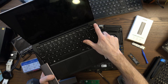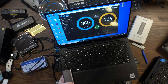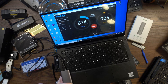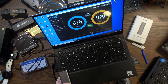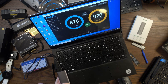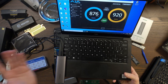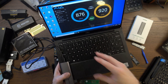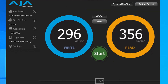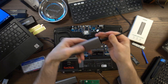Sales pages aren't always that useful, so you're better off testing things yourself. You can see the benchmark here — the target drive is the D drive, not the C drive. If you push start you'll get just below 900 megabytes per second for writing and just over 900 megabytes per second for reading. That is what you'll get with this enclosure with different NVMe drives on the market. These speeds will be a little slower if you connect via regular USB 3.1 Gen 1 or Gen 2 with only a 5 or 10 gigabit port rather than Thunderbolt 3.